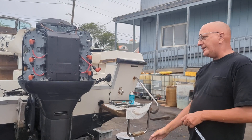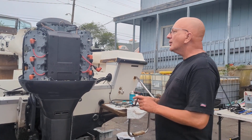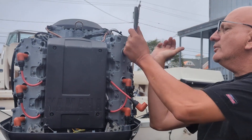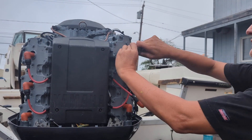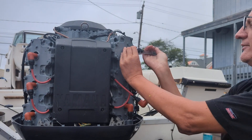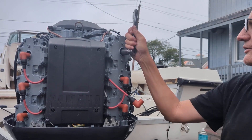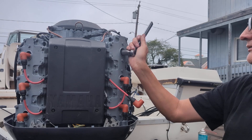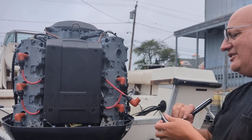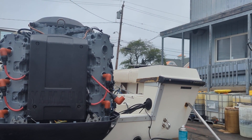It's right to left, the opposite way you read. You take one spark plug off, and ideally use a remote starter — it's probably better not to crank it over with the key. If you crank it with the key and you take all the spark plugs out, you'll have spark on each cylinder and can actually cause a fire.